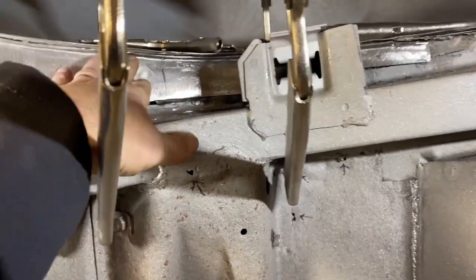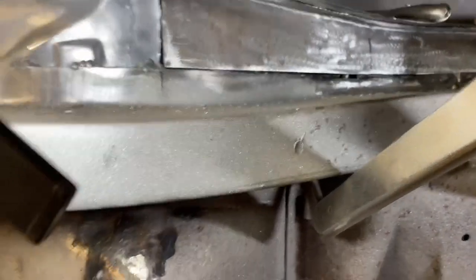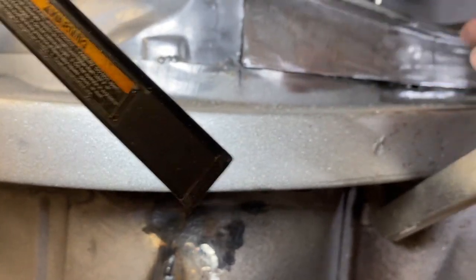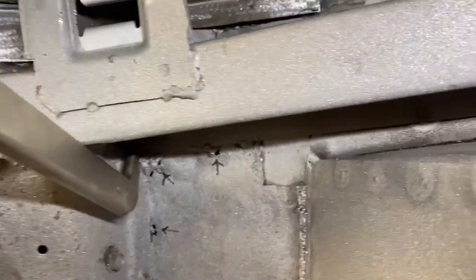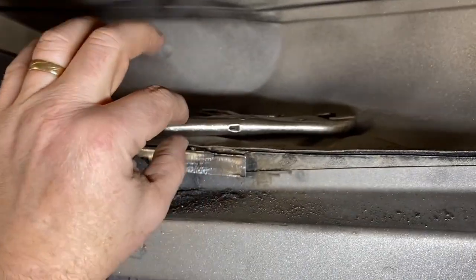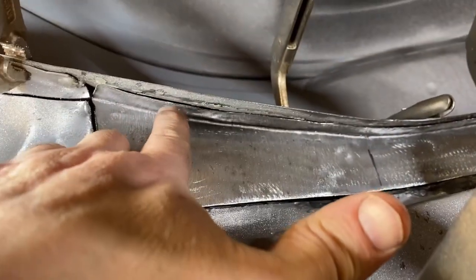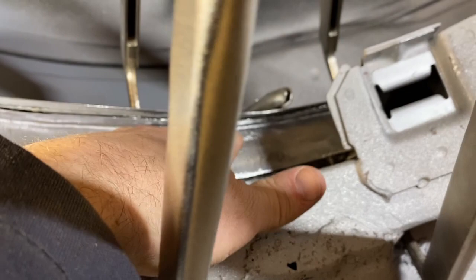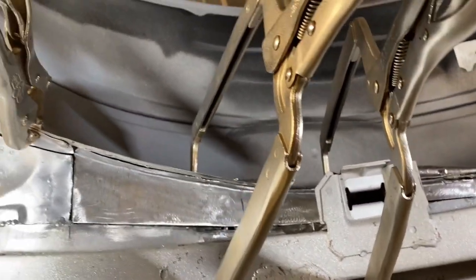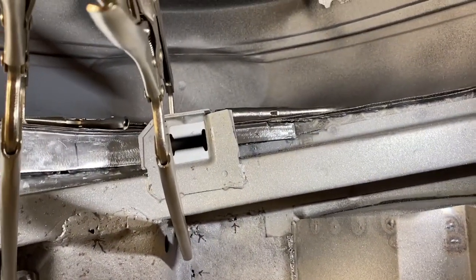So you can see how this fits — I'm just kind of holding it in with my hand. I will weld those two joints there. Look at that stay. I will weld along the bottom here, which will join my patch to the frame rail, and I'll seal that up. On this side I'll clamp it tight, and weld this side to the frame rail. It will pull up a little bit, and then it'll fit above this joint here. And then I think I'm going to try to get on the underside and I will tack weld — well, I'll weld, but probably not continuous — the joint there. And then seam seal it all once I'm done. Next I'll be moving on to these gaps here. Time to clamp it in final and start welding.